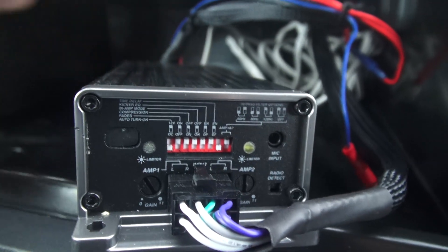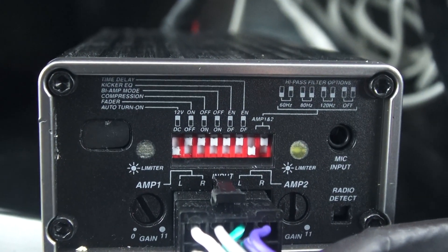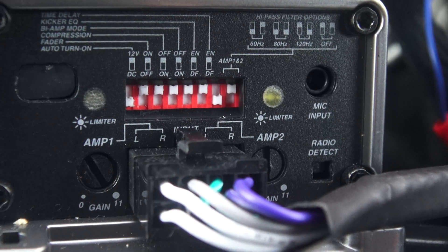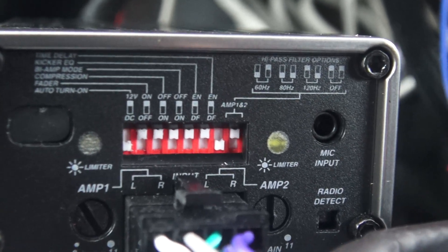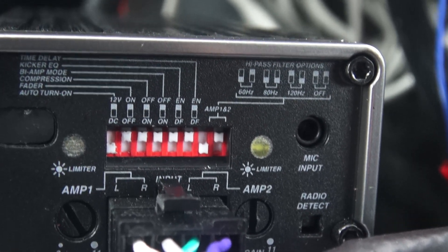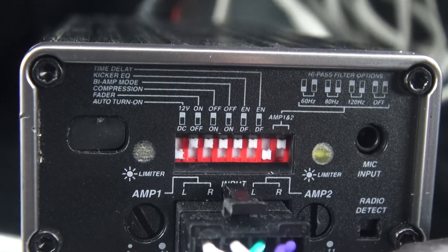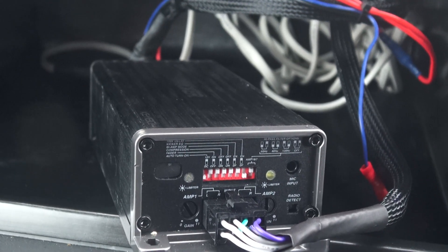So, so far, so good. There's an awful lot of switches on the end here though. This is way more than just merely making it meatier and bigger and badder. Tell us about what this thing can do. Well, it's an amplifier — 4x45 watts — but it's not just an amplifier, it's a smart amplifier. It's got a built-in powerful 40-band EQ, time correction, and also built-in crossovers. Those built-in crossovers are controlled by those two switches on the end, whether they're one up one down, both down, both up, or the other combination — giving you three crossover frequencies and off, so you can use it full range. There's also another form of crossover built into the real-time self-setting, where it'll detect certain vehicles such as BMWs which don't have a tweeter in the front, and it'll detect that and adjust its crossovers accordingly.